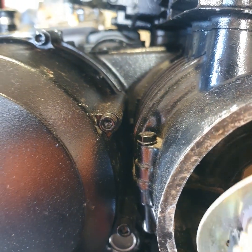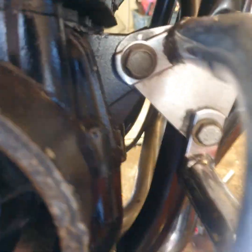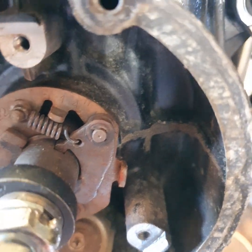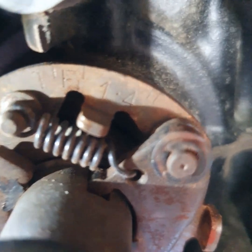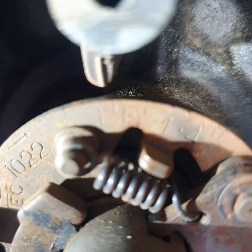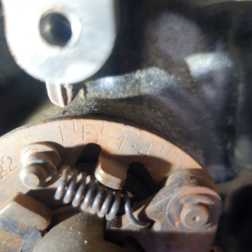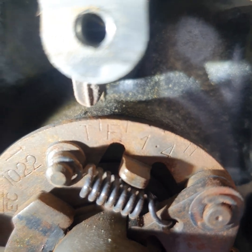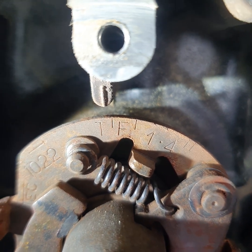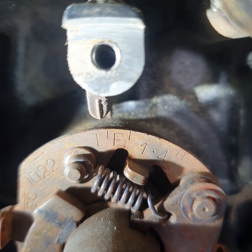If I lift this off, you can probably see the marks on there if I get a torch. Yeah, you can see it quite well there. There's your mark — C, T. It's got to be in line with that peg behind. That's pretty much what it's got to line up. You can see the T there and the timing mark, and you should be able to see that through that little gap. That's what we want, and that's on one and four.